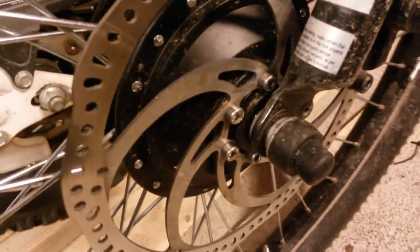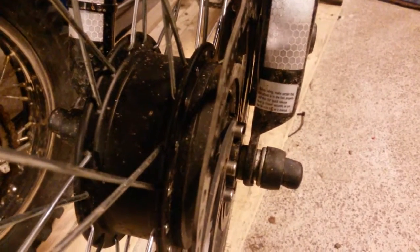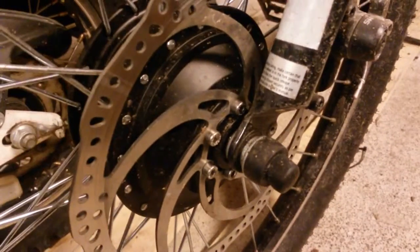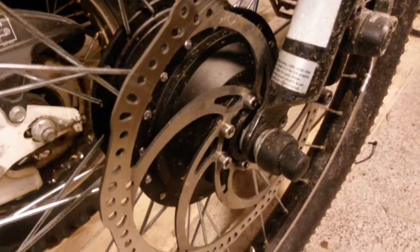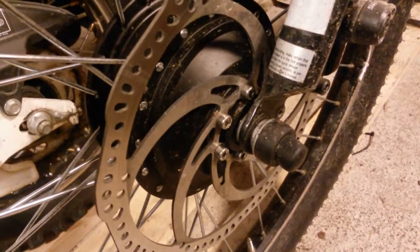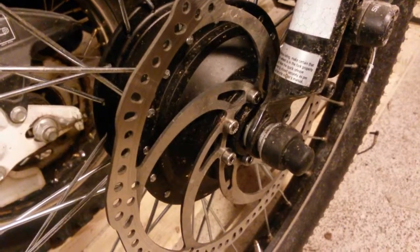Now the new screws are all installed. You can see that the head of the screw is quite a lot bigger than the old one, but it doesn't matter. There's room for the screws to rotate there between the fork dropout. So I'm pleased with this change, as I think that in any case of issues with those screws, it will be easier to remove them safely.